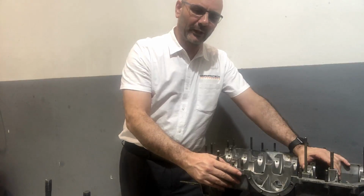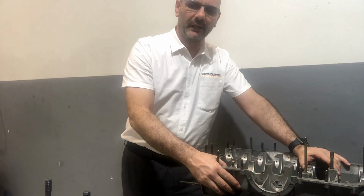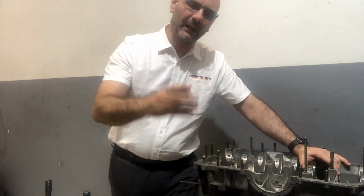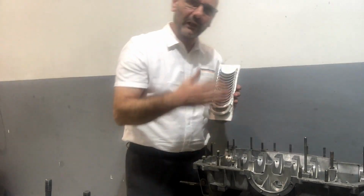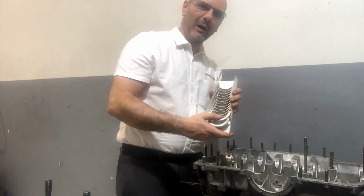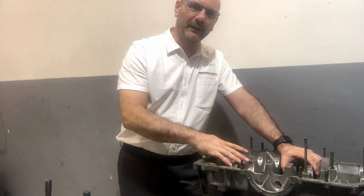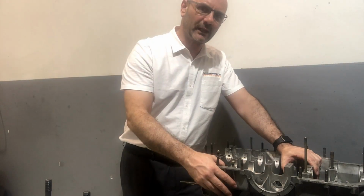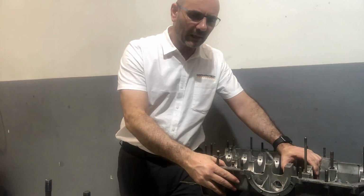Okay guys, we have assembled our crankshaft. We are now going to insert the crankshaft into our crank housing, to then assemble back the engine block. Earlier you saw how we fixed up our connecting rod bearings. This time around we have a set of new journal bearings for the crankshaft, so we're going to mount this along with the oil pump of the car. Personally, I like to assemble the crank housing on the working bench, and once it is completed, we'll move it onto the engine stand, which allows us to turn the engine around and work on the engine from all directions.